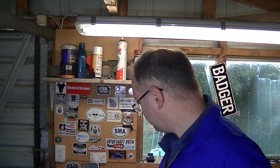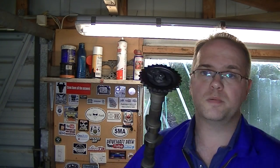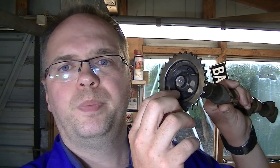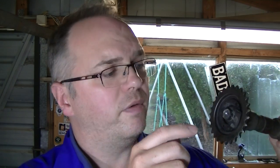So what options have we got now? Well, I could get a new sprocket, which I may well end up having to do. A new sprocket is $130 plus tax and they're ex-Germany, so it's three weeks away from the Volkswagen dealer. Plus I also need a new Hall position sensor — those are pretty cheap, like $40 or something. But it's more this sprocket. There's nothing really wrong with the sprocket, and for $130 I might as well try and get this off.